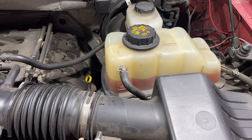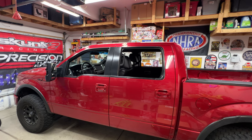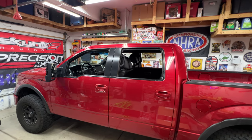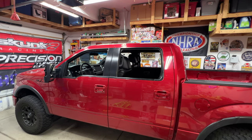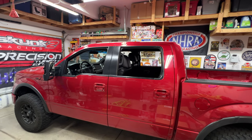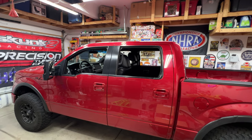That's going to be it for the video. This was a 2011 Ford F-150 with the 5.0 Coyote engine — we went ahead and replaced the heater core inlet coolant hose. It's a common issue on these 5.0s where it starts to leak at that connector. Hopefully this video helps you out — if it does, why don't you subscribe to my channel, check out my other videos. I'm going to have quite a few on this truck alone, and I'll see you in the next video. Thanks.